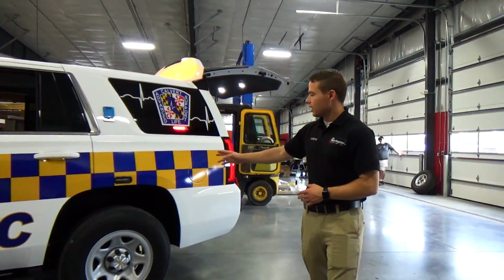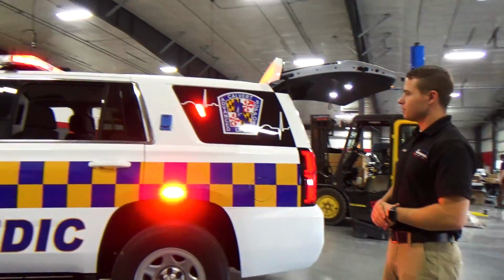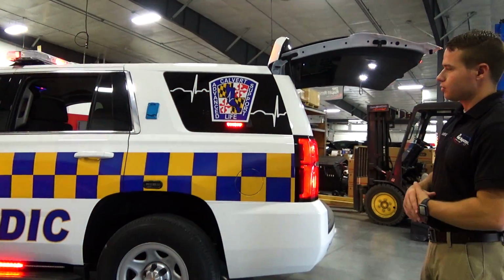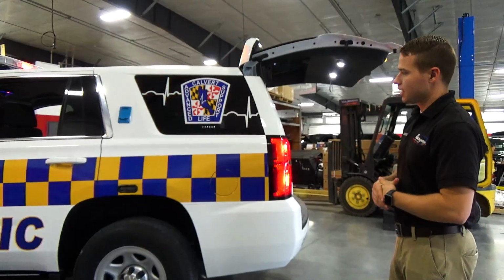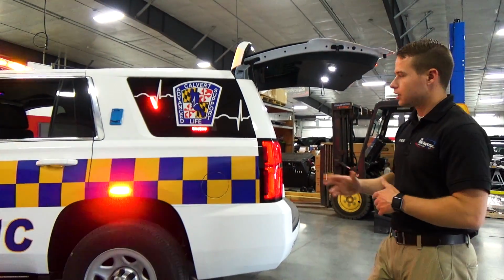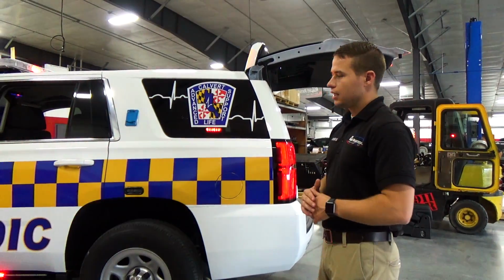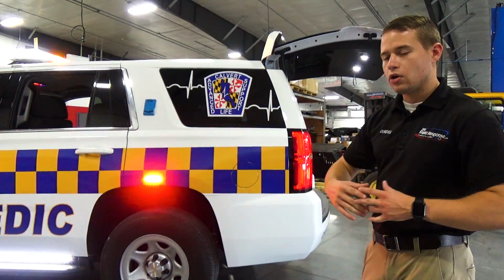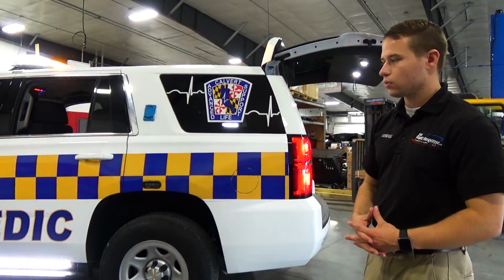The Carbide, again, we have the duo color Ions in the rear of the vehicle here. You're noticing them flashing simply red now, and then in position 3 they are able to switch over to that red and white flash. And you'll notice when we do flood the vehicle with scene lighting, we actually keep some of these lights flashing in order to preserve the warning that you are offered, so you're not having all of your lights steady and losing all of your warning.